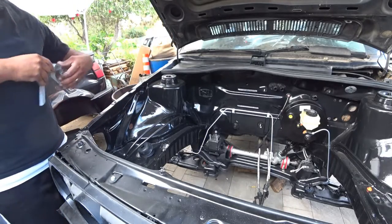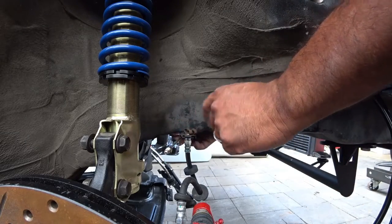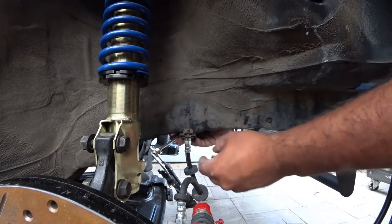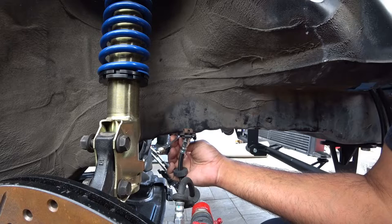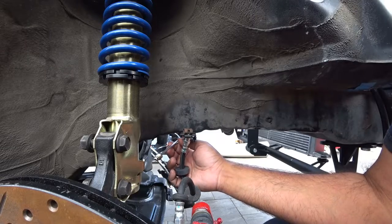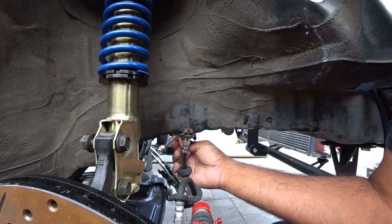You can see where we ended up — really nice and close to the actual brake mounting point where we need it. Now while we're here, we've got to figure out going up and down. Obviously you can't go anywhere from there. Now that we know where we're at, we need to go full 90 straight up and then rotate it back down. That's where your complication comes in on your bend — it's going to be a very difficult bend, but it's very doable.